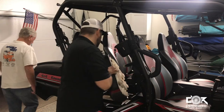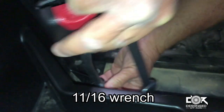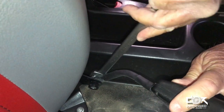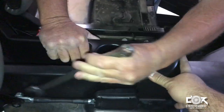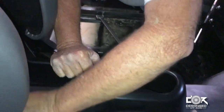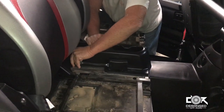We're going to get the cushions out and set them to the side. My dad is here working on his T4. You're going to use an 11/16 wrench to remove the seat belt — remove that one and this one, and that's it. Then we'll get ready to install the bump seat. It's pretty easy — you don't even have to remove the center consoles at all. With the bench option these have to get cut out and taken off, so you're kind of stuck with it. But this is a good option because you can remove it, resell it, and go back to stock after the kids outgrow it.